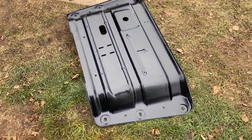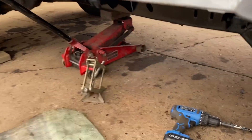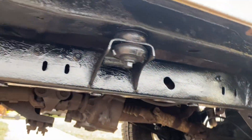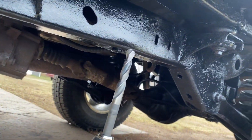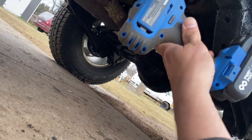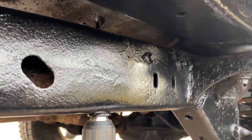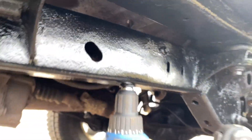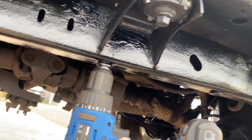All my repairs are done - check out the skid plate, repainted. I'll show you the best and easiest way to put this on that solves the issue forever. I got myself a drill bit the exact same size as these holes. I put it in like this, using a little car jack underneath the drill to make it easier so I don't have to push hard, and I drilled all the way through the frame. I did it to that hole and this hole - tons of room up there.